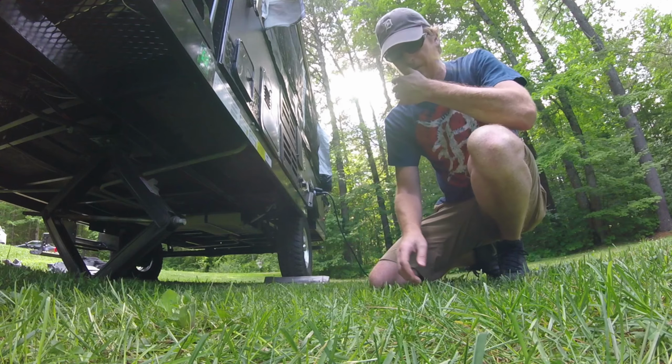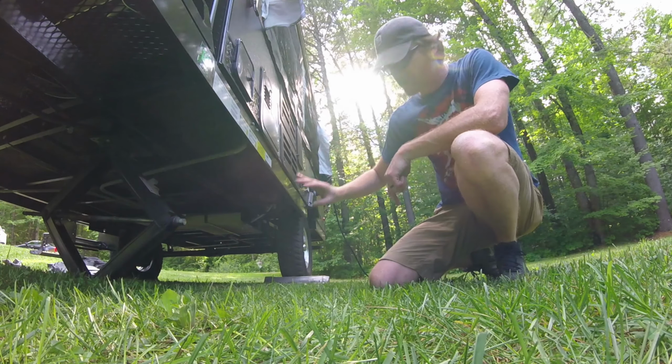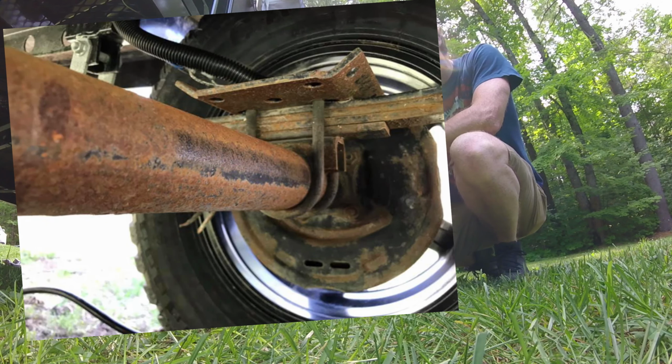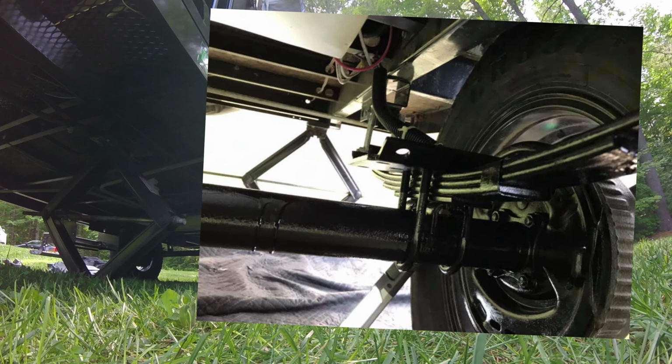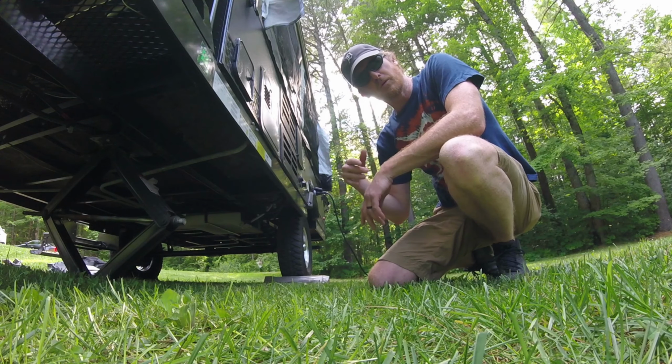I've since cleaned it up, but the entire underside was covered in wintry salt. It had stripped the paint off the front facing area where the splash hit. So I used a wire wheel, sanded everything, and painted everything, hopefully just to seal it up so it would last. And then I noticed it was dog legging or dog tracking.